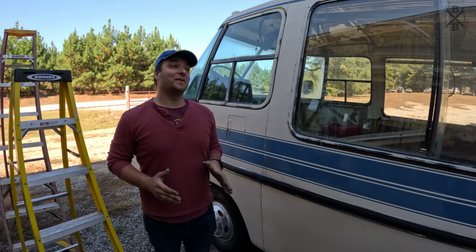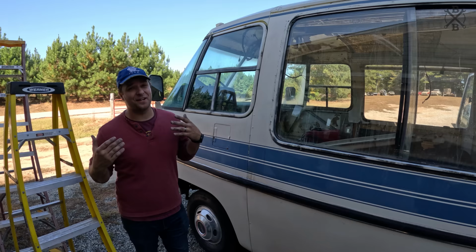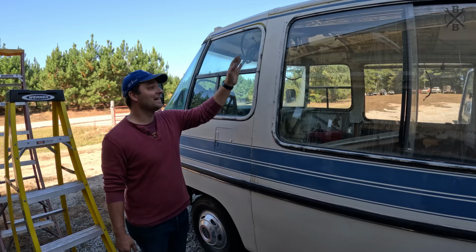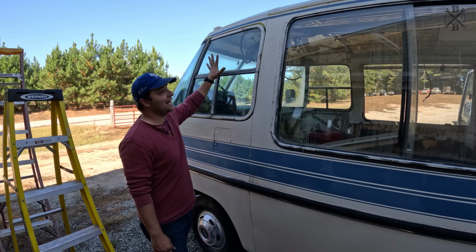Holy cow, talk about time consuming, but what a huge difference. And that stuff absolutely had to come off of there. Obviously went ahead and got the goofy tint that was on the outside of that window off. And then we also pulled out all of the silicone RTV from around this window, because you can see where it's separated at the top, and that is where we were getting our leaks.